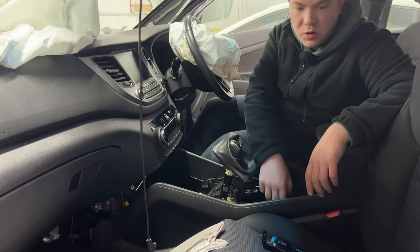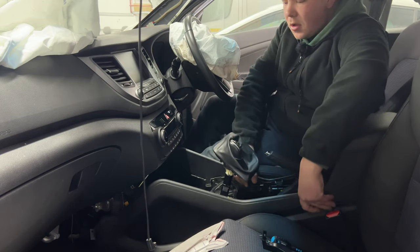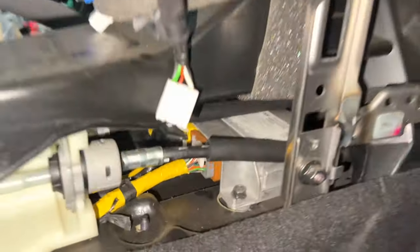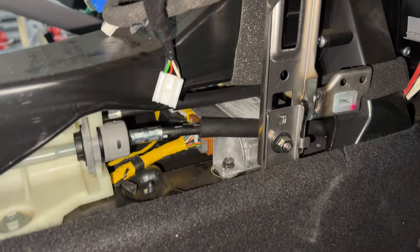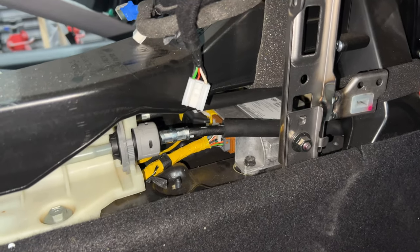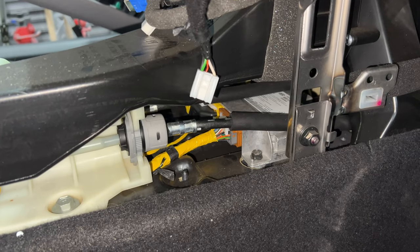There is one heater channel which goes to the rear vents that, when you pull it back, will separate. So if you're hearing noise, it's nothing to worry about. With the centre console now removed from the vehicle, that exposes the SRS module — this silver unit just here. I need to swap it out on this car. It's not like a VAG car where you can just clear the fault codes on diagnostics; you either have to replace the unit or send it off to a company that can clear the crash data. I want to get the dashboard in first.